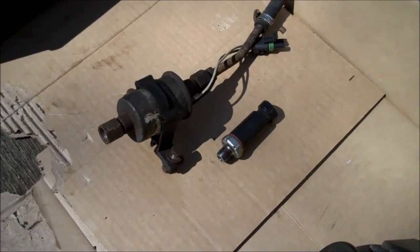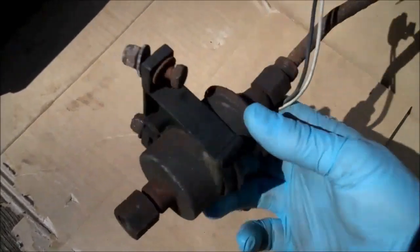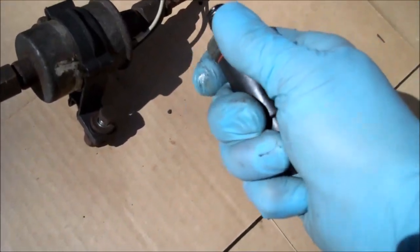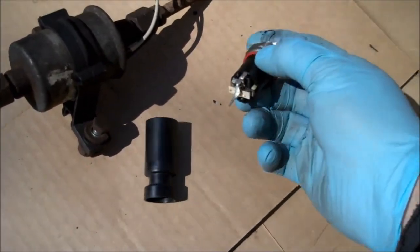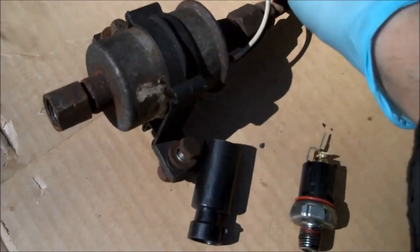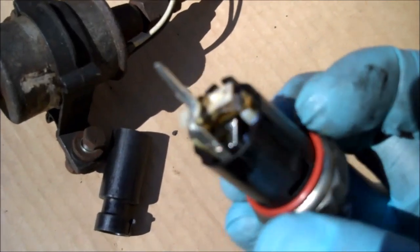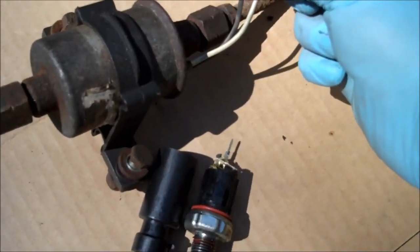Next is the lift pump that GM put on this engine — it's a joke. This thing wouldn't even run my weed whacker. It was so cheaply made and so weak, it's just engineered to fail. And on top of that, the safety engineers at GM put an oil pressure switch on there that regulates this fuel pump and runs the electrical load. The electrical load going to this fuel pump through these wires is run through this oil pressure switch. Can you see the wiring in there? How flimsy that is? This was never meant to run the load going to this fuel pump.